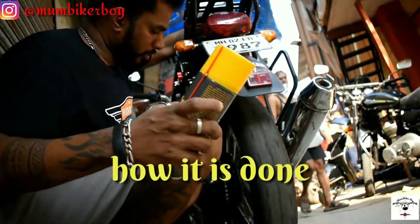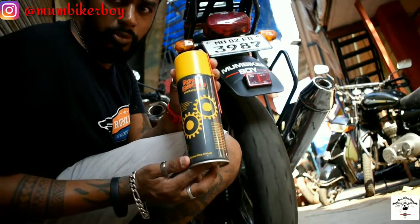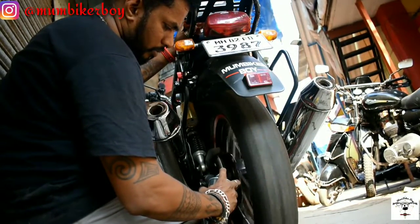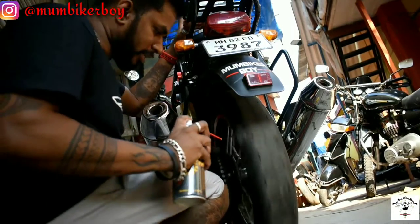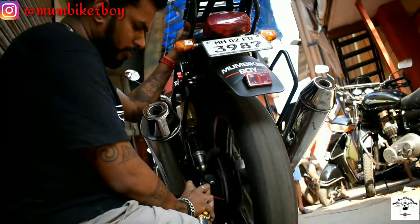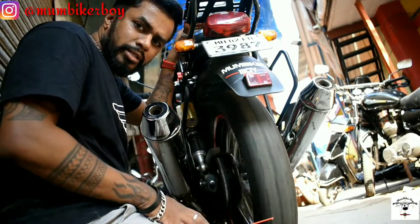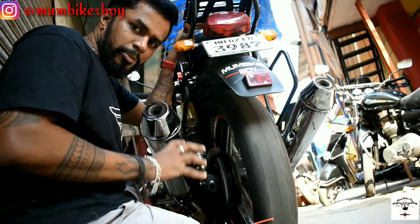The chain lubrication is right here. The bike is running and put in first gear. Using the chain lube from Royal Enfield, you don't need to spray excessively — cover all sides. Let the bike run for at least two minutes so the chain and both the front sprocket area get enough lubrication to keep it moist.